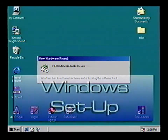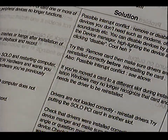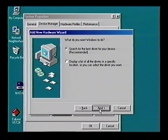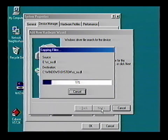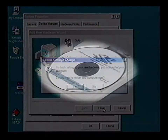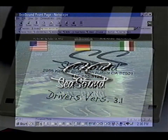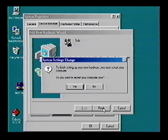For Windows, your operating system should alert you to the presence of a new PCI card with an on-screen message. If you don't get this message, don't freak out — refer to the tech support section in the Solo Manual for troubleshooting hints and the C-Sound technical support number. Completing the driver install in Windows is simply a matter of pointing Windows to the disk that has the Solo drivers. For the initial setup, this would be your Solo CD. In the future, you may have updated drivers on a floppy or downloaded from our website onto your hard drive; in either case, direct Windows to browse for the drivers there. Once the drivers are installed, restart the computer.